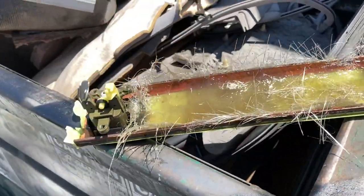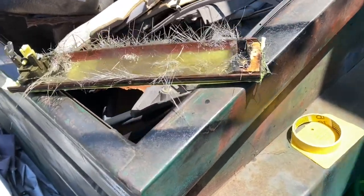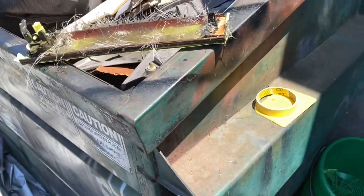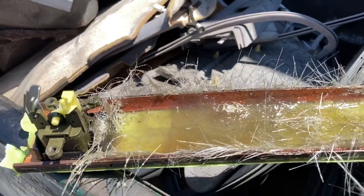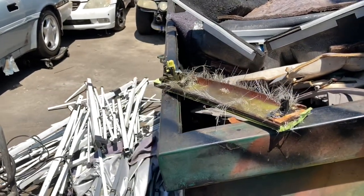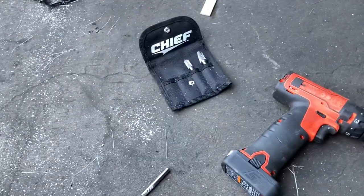I have this little idea — I'm making a little fiberglass piece right here, fiberglass-ing in the little panels because I went ahead and removed the AC vents to get his BTI MK3 unit to fit in this. This is kind of the first run of trying to see if this unit will work here. The fiberglass has to dry, it's going to take a little while. I have to trim all this stuff off at the end, shave out the section I need to make the BTI fit and clip in, then just run two screws through it. It should look pretty good when I'm done — sand it, put a little primer on it, paint it black, and bolt it in the car.